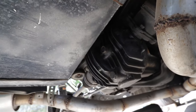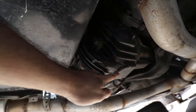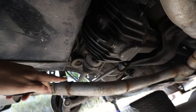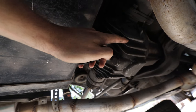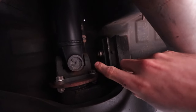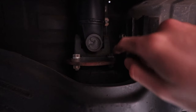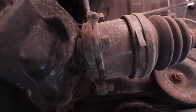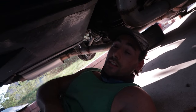So there's the axle right there. This piece is a lot like how the Miata was except up at the front it's a little bit longer. Looking at this, I may just have to pull the axles, but I think we should be able to pull the diff out without worrying about the exhaust. Up in here we've got two bolts at the back, we need to unhook the driveshaft, got a bolt on each side, and these axle stub bolts — so I've got my work cut out for me.